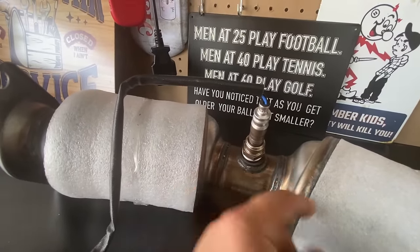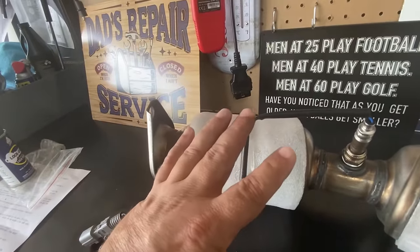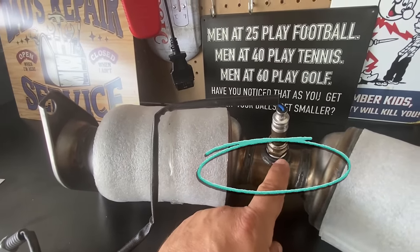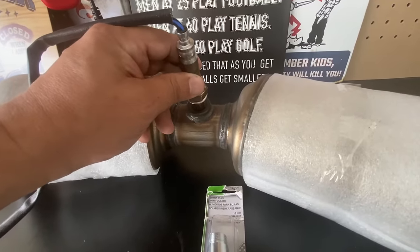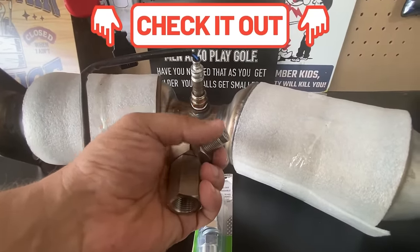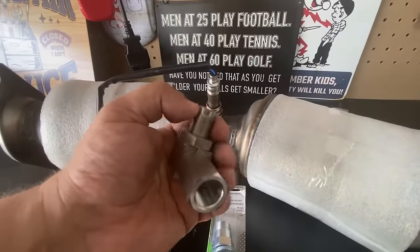The real magic of these aftermarket catalytic converters is this particular hole. When this hole is protruding out a little bit, it keeps the oxygen sensor a little bit out of the way of the exhaust and less likely to throw a check engine light — such as a P420 code for a catalyst deficiency. For example, your catalytic converter might only decrease efficiency by four percent and trigger that code. That small adjustment in the hole position makes it less likely the check engine light will turn on. The same idea is behind a spark plug non-fouler — a spacer that keeps the sensor back a little further, allowing it to sample less air and keep that check engine light off. They have little mini catalysts too, and they do work. So if you have an intact catalytic converter and you're using your vehicle for off-road purposes and you're tired of seeing that check engine light because the vehicle is detecting that the catalyst is bad — this is the magic right here.